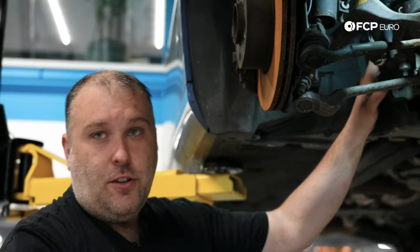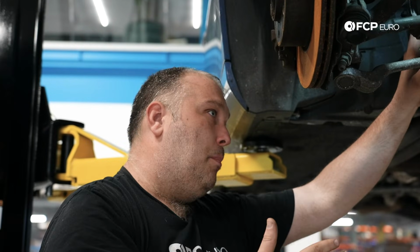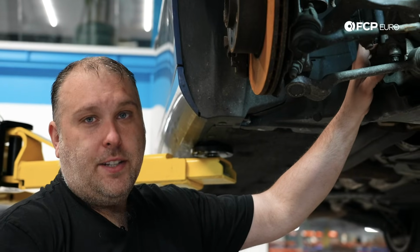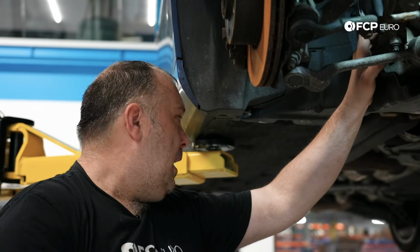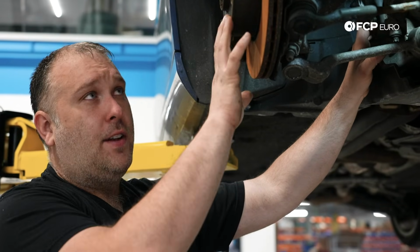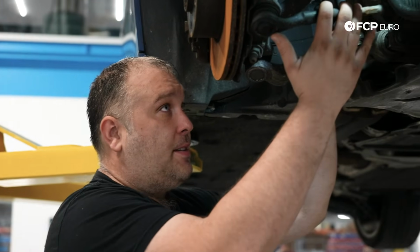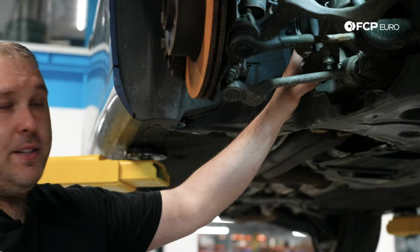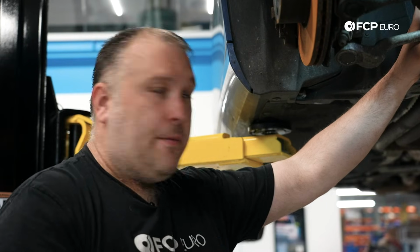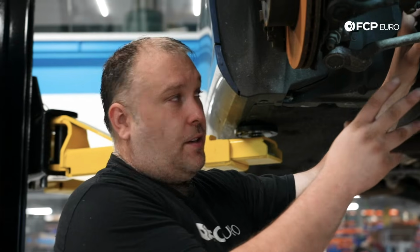Obviously, we're looking at the front suspension. Rear suspension is going to be a little bit different. You don't have the steering component aspect of that, but you could have a situation where components in the rear suspension are bent, causing a toe out or a camber problem, so that's another area that you want to look at as well. But generally speaking, the front suspension is the most sensitive to these impacts, just because you also have the steering components and everything else. But depending on where the car was hit, or which corner took the brunt of the impact, you'd want to inspect that and make sure that there isn't a lot of external damage or damage that has been shifted to another side of the car.